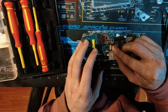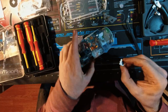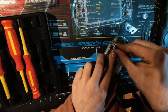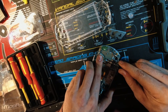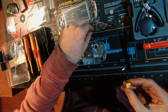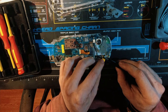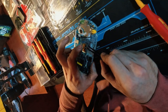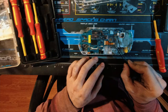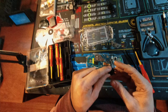Since we're here we can plug these in. Now we can do the speaker — make sure the little tab goes right there, and then this one just has to move over so that way it locks on top of it. And that speaker's in. Now we can do that DC jack right here with the screw. Roll the cable management, just lift this up and get that in, screw for that. I'm just going to make sure this ribbon cable goes in there — it has a little channel where it's supposed to go so it's not going to bind.